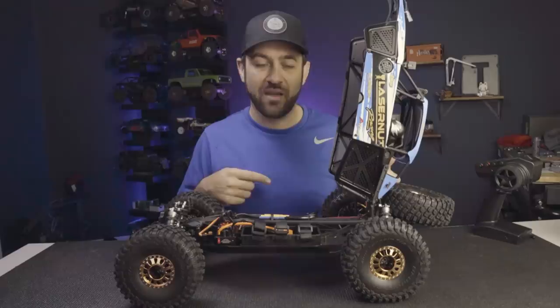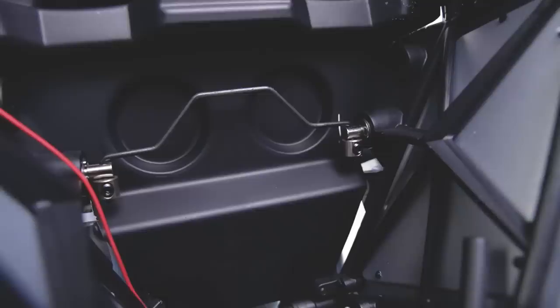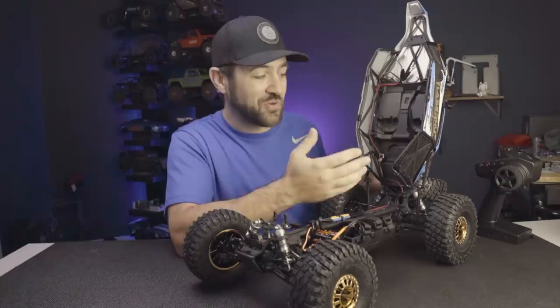like a kickstand, kind of. The sway bar is a multiple piece design. The torsion rod that goes between the two halves is separate and is retained by a small collar. The rotation point for the sway bar arms has two bearings on each side. So there's four bearings total in this sway bar setup alone.